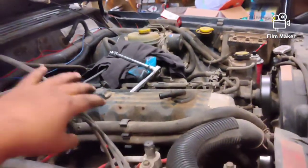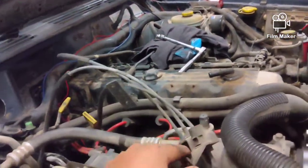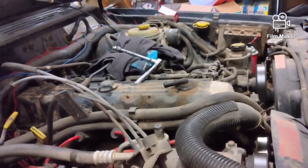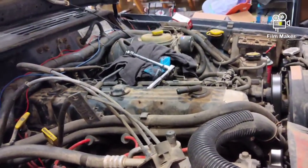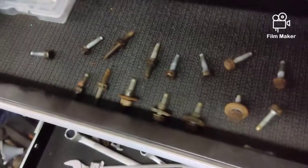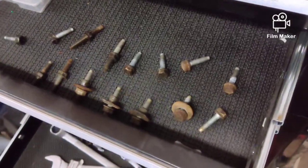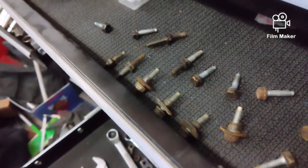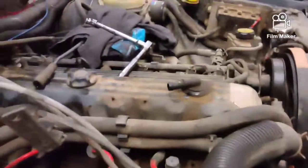We start by taking the intake off. I removed the bracket that holds all the throttle cables on, and then I took all the bolts out of the valve cover. My intake tube is very easy — it's just one clamp and the whole assembly comes off. We get all the bolts out. I lay the bolts out how they came off the valve cover so I know how they go. We have the new valve cover sitting up there, and you'll see it's got these washers that go inside the rubber seals on the valve cover. You can try to pop them out as you take it apart, but I'm choosing to leave most of them on the valve cover itself.